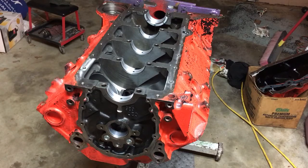Or well, let's say this, at say 1,000 RPM cold start idle, you were holding between 65 and 70 pounds of oil pressure. And if you tried to drive it before the engine oil warmed up fully, at 1,500 RPMs, you were pegging almost 100 pounds of oil pressure, which is absolutely ridiculous.